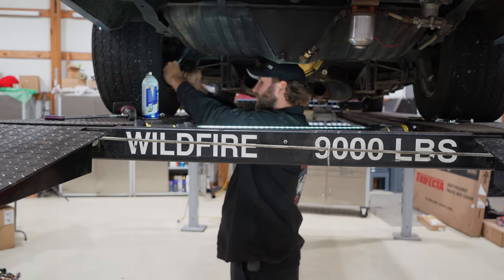The old timer, you know, back in the day, did what he could with the double hump heads and bored out and did all this stuff in the cam, and then was trying to make it up with the rear gear, and that's why he went to the tall tire. Because we were at, here, I'll show you this. We were only at like 80 miles per hour when it was really rolling over, 85 maybe, you know, up in there. Yeah, by the time you get to 85 miles an hour, you're only making 100 horsepower. Yeah. So, yeah, that's why he had that big old 29-inch tire. It's kind of hard to see. It's clearly a lot smaller.